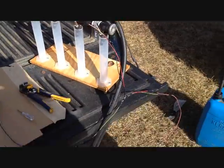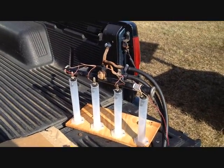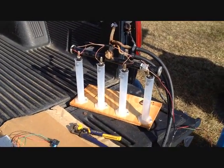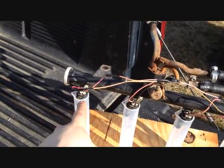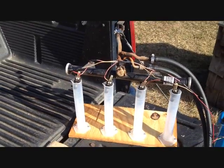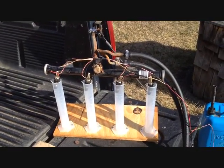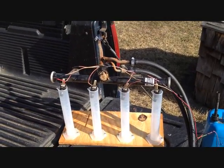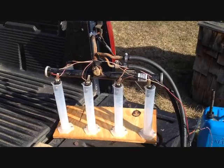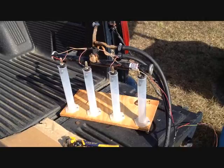I already test-fired the pump to make sure it would work, and found out that this fuel injector is already leaking. Proof of concept right there — I can check these injectors at home just even for leak checking. I hooked the fuel pump up to it and it just started dripping a little bit, so I know it's bad or it just needs cleaned out. I'll have to see if I can clean it somehow and get the seal up.